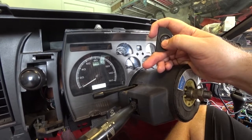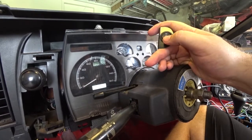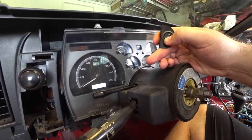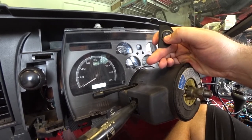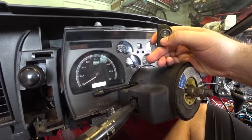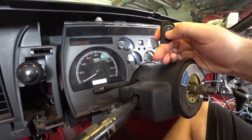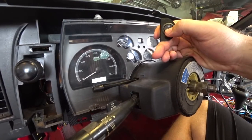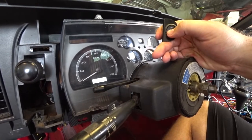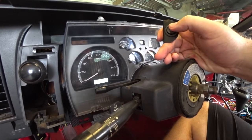Update, nope. Well, I can warn myself. So it's 6,000 RPM. This thing's gonna yell at me, tell me to calm down. Okay. Signal strength, so this is the voltage. So I have it on 5 low, which I believe is what these systems require. So I'll find out when I'm driving down the road if this thing works or not. Or I can do 12 high. Anyway, it's just a quick, simple switch. But that's the tach setup.